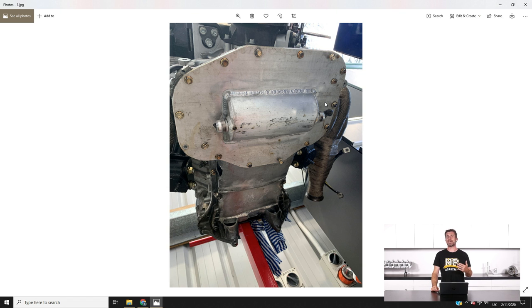It's a fine line though - you can't just say that more vacuum is always better. You can get yourself into a situation where it can be problematic if you're pulling too much vacuum in the crankcase. This can actually be a problem at high RPM wide-open throttle, where we've got a lot of blow-by going past the pistons - particularly noticeable on high-boost turbocharged engines.